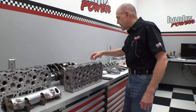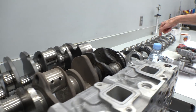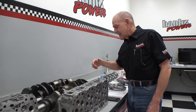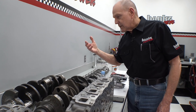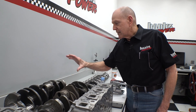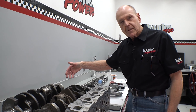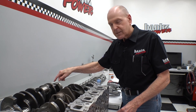Here's one of our crankshafts back here. We currently do a big-pin billet crankshaft design with our own con rods, which are larger than everything up to L5P — though not as large as L5P, because I want to spin the living snot out of one of these things and go well over 6,000 RPM. Before the L5P was even on paper, we had done these big-pin cranks. The bearing size is a trade-off — these are stroker cranks, and we built 7-liter 427 engines with a half-millimeter overbore and the stroke increase we have here.